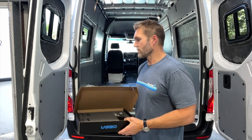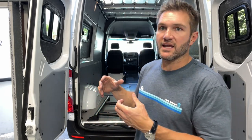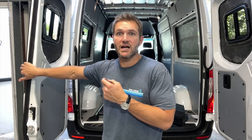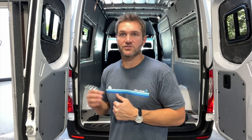Important thing about drilling the door: there are a number of folks out there copying what we do, but they don't copy the engineering of it. It sounds nicer to have a no-drill option, but we've done a ton of engineering and destructive testing. The way we mount this is by far the strongest — we put the weight on the hinges, which is a load-bearing item, and the hole through the door is in a strategically located spot for the strongest possible attachment. No-drill options often end up cutting through weatherproofing — which keeps water out — and grinding down latches that help close the door.